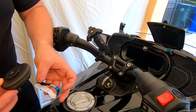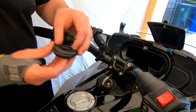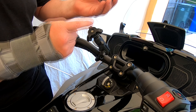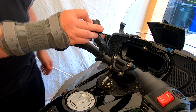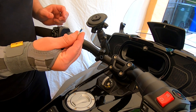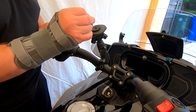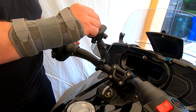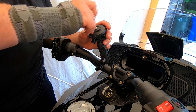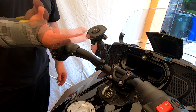Take the label off — now you're left with this piece. You've got to hold this together because this will come out. This piece interlocks onto this piece, however you want to put it on there. Just make sure there's clearance for the wire to get inside. Then take the bolt that comes with this adapter — it already has Loctite on it so you don't need to add any. The bolt goes right through the middle and then you tighten it down. Nice and snug — that's basically your whole assembly right there.